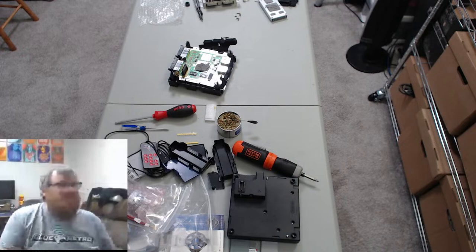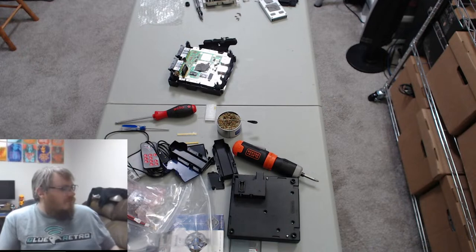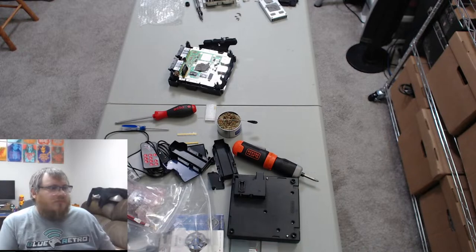All right, so what's happening right now is exactly what Greg said. As soon as I dropped the file onto the Raspberry Pi Pico, it ejected itself, so it made that USB ejection sound. And the light is now green. Did it flash? Does it flash super quick? I think it going green just means it's done, so you can unplug it and use it now.